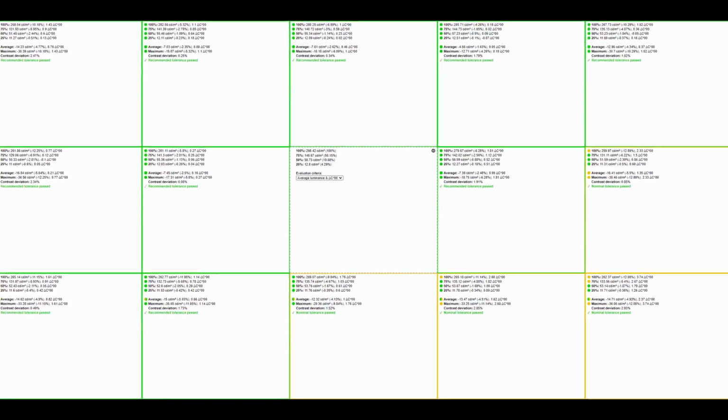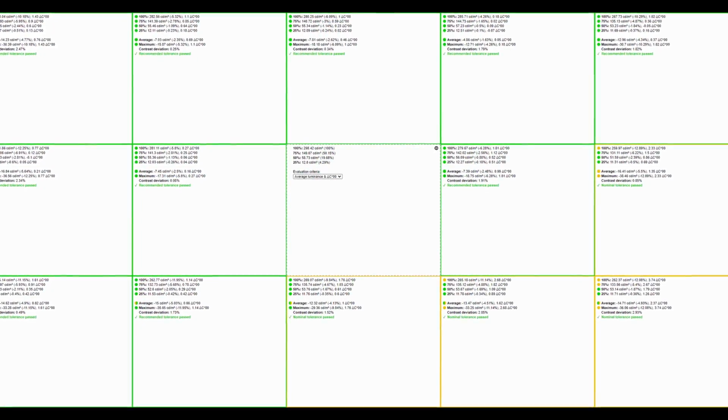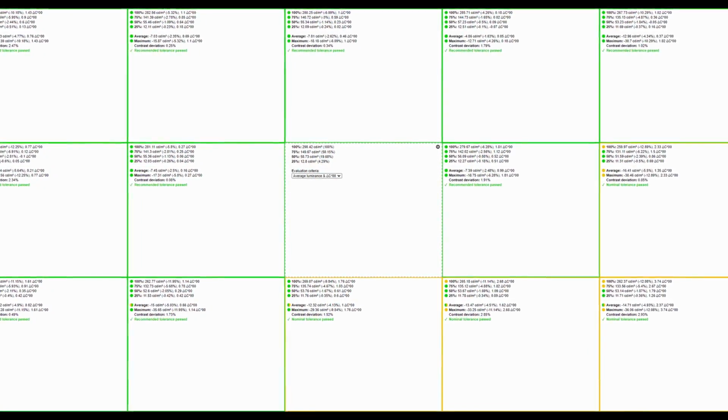Past the overall luminance figures, we should talk about brightness uniformity, and here on my tested panel, which I appreciate is somewhat lottery, it actually did fare pretty well. The same could also be said about the overall backlight bleed, which I found perfectly acceptable even while playing darker movies or games. But of course, if you're susceptible to this, or you're going to be predominantly using it for watching darker scenes, then you might want to consider a TN or a VA panel altogether.